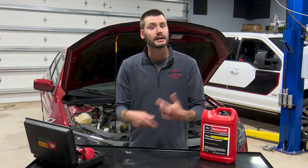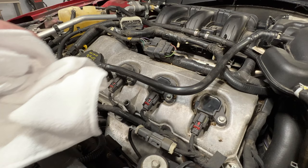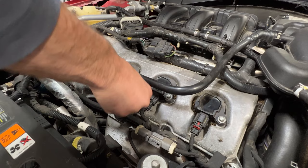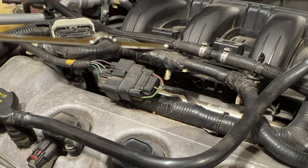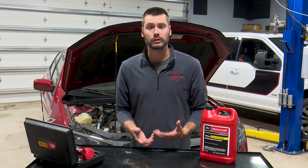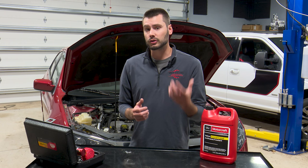So when we check the oil level on here, you can see that the engine oil is overfull. It's also got a funny color to it — it doesn't exactly look like nice clean engine oil, even though the oil change sticker shows it hasn't been changed that long ago. It should look a lot cleaner than this. It's almost got a milky color to it, and that's not uncommon when coolant and oil start to mix together — they get this milky, almost chocolate milk color to them.